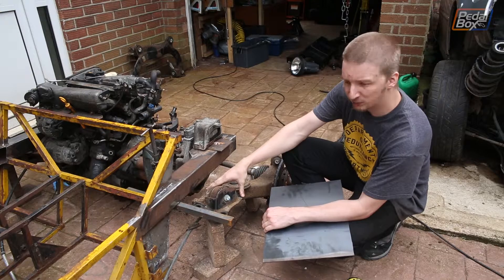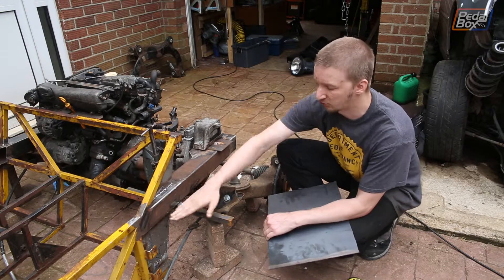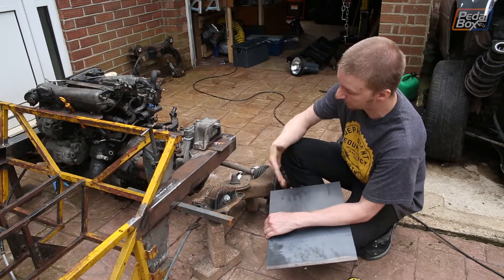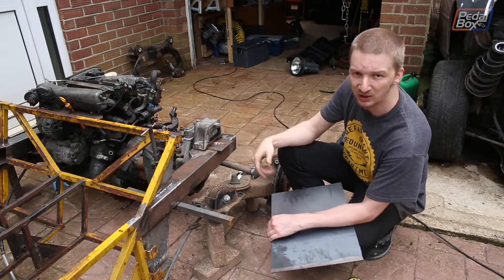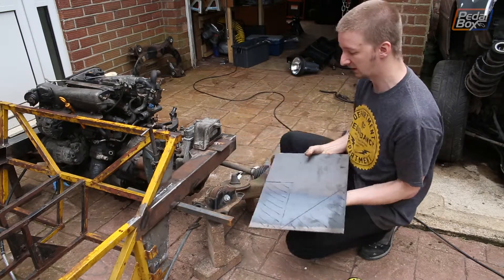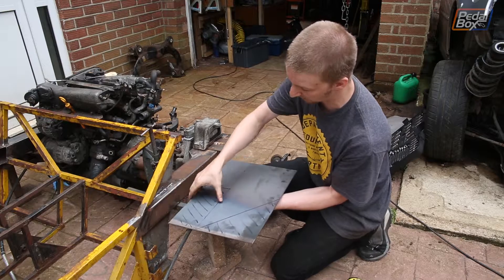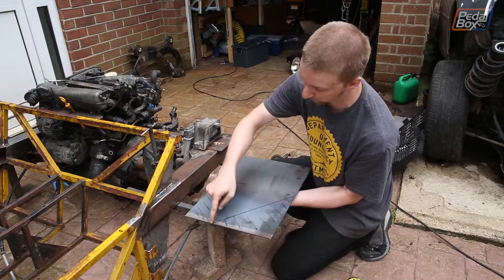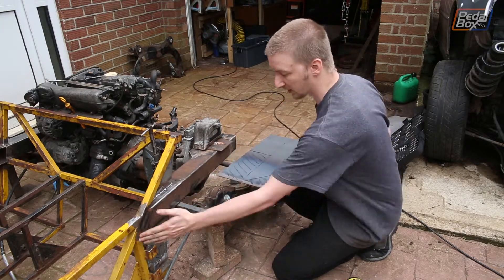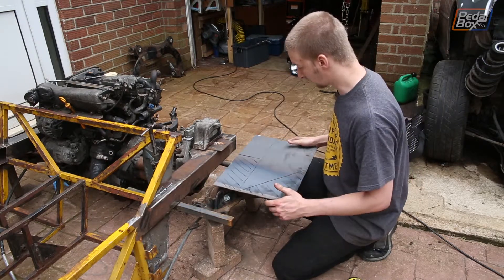What this means is we're still going to have to build roughly the same kind of plate arrangement so that this has got a big platform to bolt up onto, and we're still going to have to attach it into the bottom of the chassis the same way, but we are going to have to have a lot more metal to actually reach out as far as it protrudes. And then obviously we're going to have to add a lot more strength to it because it's hanging out further. So we're working with a nice big slab of 3mm thick steel, and this is roughly the shape we think we're going to have. These sections are going to get cut out, this part here is going to go inside that chassis leg, and all of this off the front we're going to taper in toward the front just to save a bit of weight and clean up the angles a little.